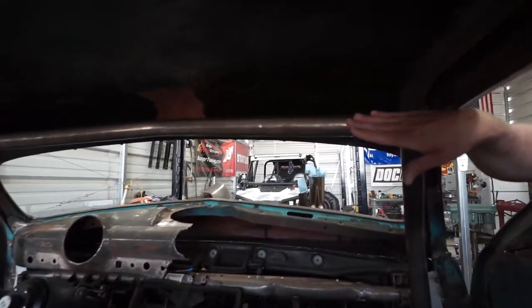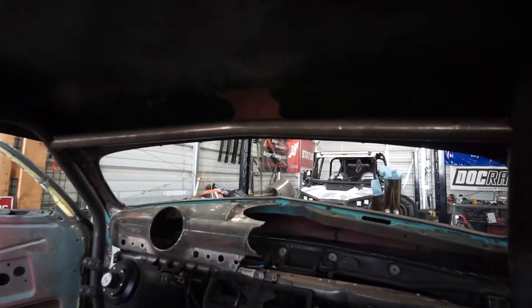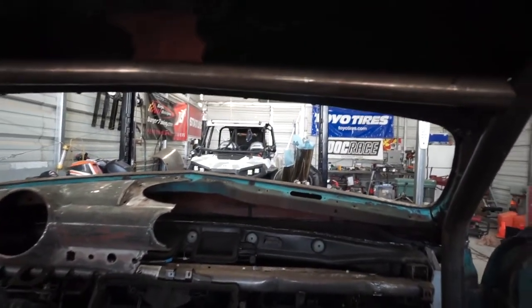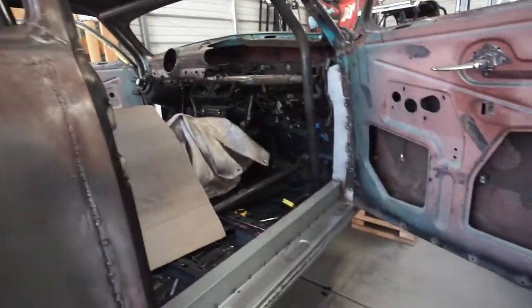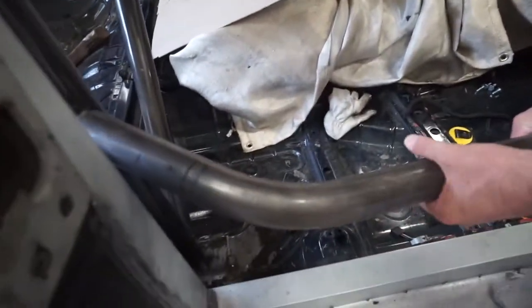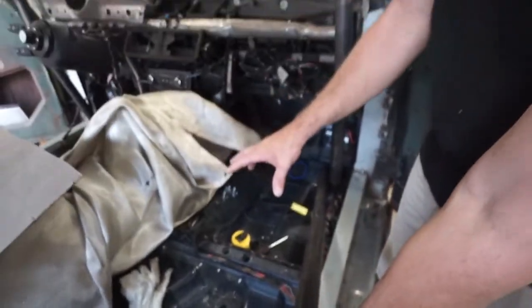After 30,000 test fits we finally tacked the top bar in — a couple tacks, got it sitting high. It's not as high as the top one but we're looking for rigidity, keeping these side bars stiff. We're going to tie in the A-pillar to the roll cage and that's going to give us the side-to-side rigidity we need. It looks awesome, and when you're sitting in it you're not looking at the bar — this is about eye level at best. Now for the side bars — this is the tube we bent wrong earlier — we're going to come out off the side, turn an angle, and the front's going to get notched to match.